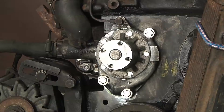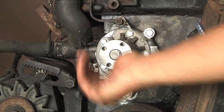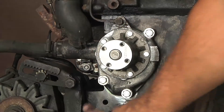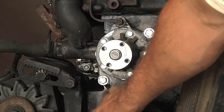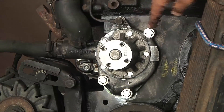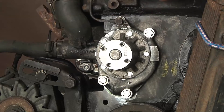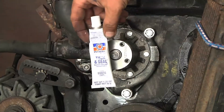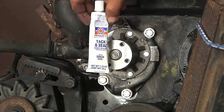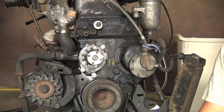Here is the new water pump — it's mounted on, spins freely, no problems. These two bolts down here go around the connection into the engine. This bolt over here just holds it in up here. This fitting lets the air out; there's a little banjo bolt up there and I made sure to have both washers on there. I installed both gaskets with Permatex Tack and Seal — I just followed the directions; that's what it said to use, a tacky sealant like this.